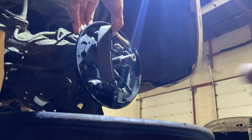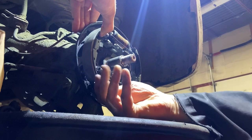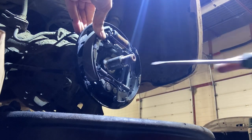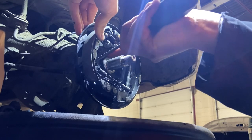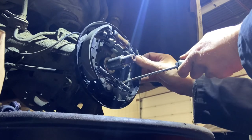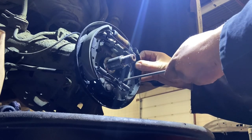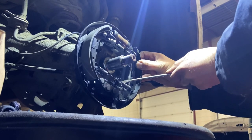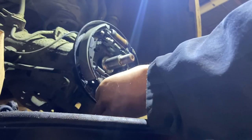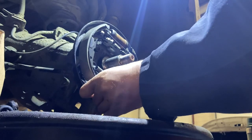Brake shoes come apart and install the same way that they come apart, but this is how I take them apart and assemble them — just as one unit. No sense fighting with all the springs separately. Just do it on the floor and you can pry them apart by hand basically. I use a screwdriver and pry on one of the four bolts that hold the backing plate to the trailing axle and it goes pretty good. Everything slides into place pretty easy.